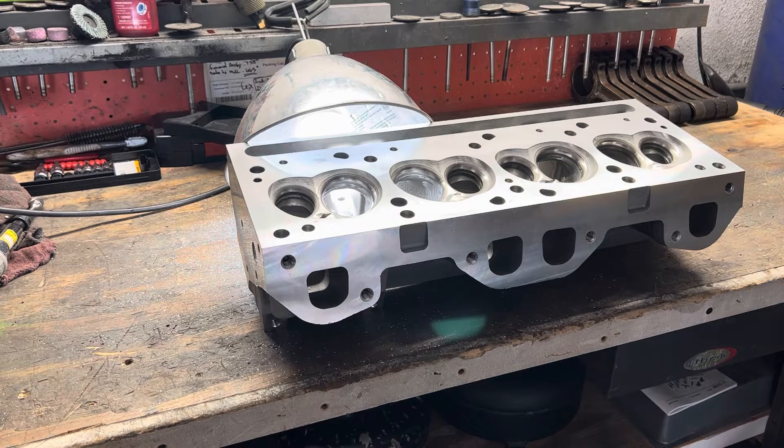Basically what I'm trying to do — and I'm going to move in here in just a second and show you a few closer-up portions — but the way this head is cast, it needs help with the transition between the valve seat and the throat and bowl area. You're also going to have to work the short turn to get what Jim Hand used to refer to as the waterfall effect. It's basically a smooth radius between the port floor and where it enters the valve seat area. You want a nice smooth transition, no abrupt ridges, to smooth out the flow so it's not trying to jump over that ramp.